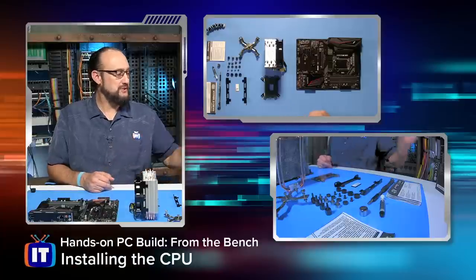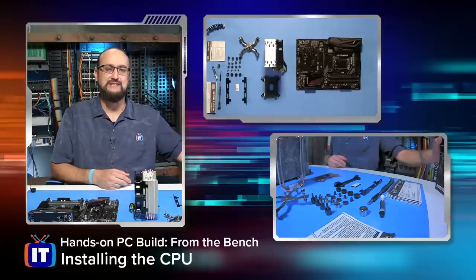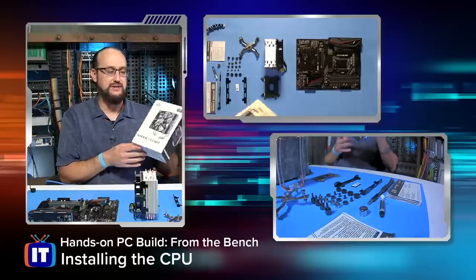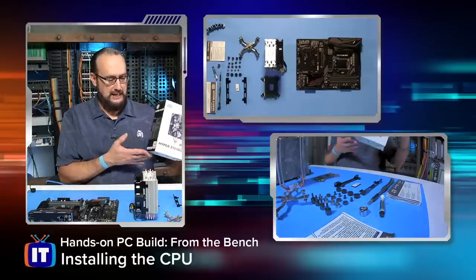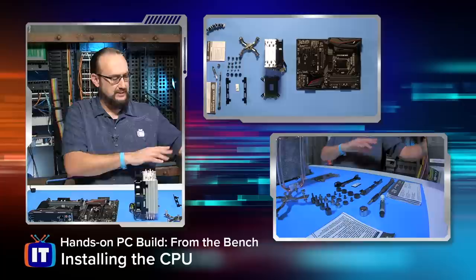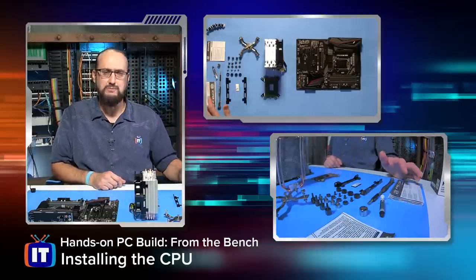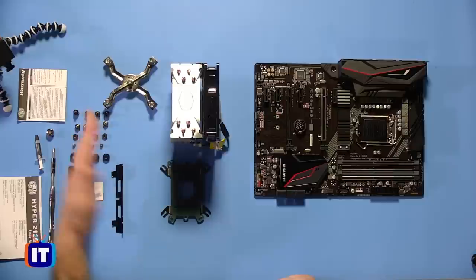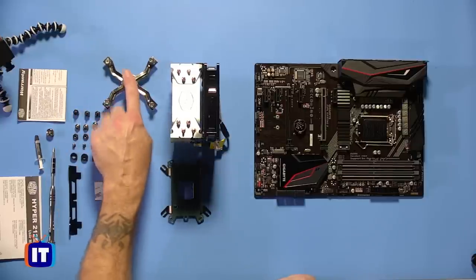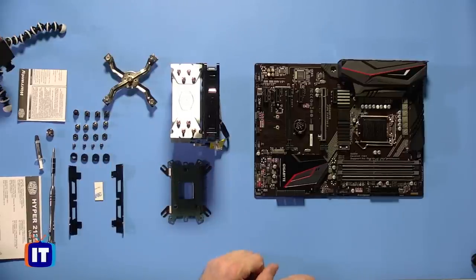First things first, we do want to install the CPU, but before we do, we've got to do some minor mounting of the heatsink and a couple of plates that need to go on before we even bring the CPU in. What we're going to be using here is the Cooler Master Hyper 212 EVO. We've got an unboxing going on here and you can see the parts and components. We have our warranty information, our user manual, a little bit of thermal compound, and a couple of bracketing mounts — because this works for Intel chips as well as AMD chips. We've got a series of bolts and screws, and the little mounting bracket that's actually going to sit under the heat pipes on the CPU and bolt it to the motherboard.